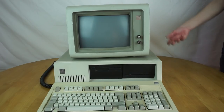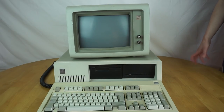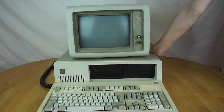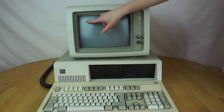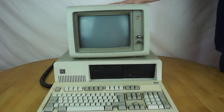We'll take a look inside and see the actual capacitor removed and everything. But yeah, we got this machine completely restored. So we can now fire it up and see it running. It's now booting up — it's doing a RAM count as you can see here. This machine has the full memory: 640 kilobytes, which doesn't really sound like much, but that is the maximum these would take without sort of extending memory drivers. It's a bunch of individual RAM chips on the motherboard.